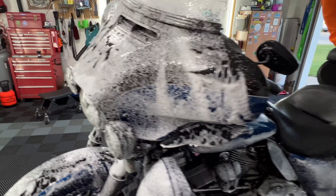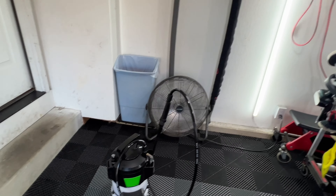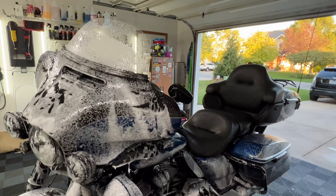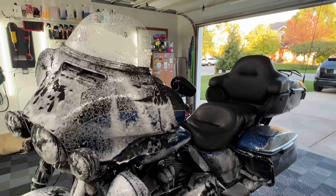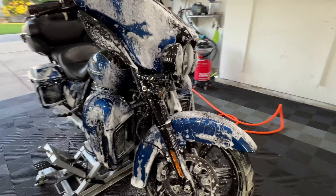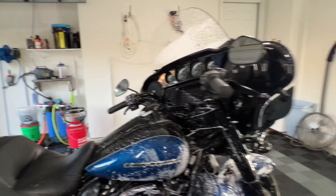We are trying to get as much dirt off with a simple pre-treat and hose method. Then we are going to foam it with my second IK Foamer with DIY Details Incredible Suds. Both IK Foamers are filled with DI water from my CR Spotless so it produces better foam. In the Incredible Suds sprayer, that's two ounces per gallon — so I have four ounces in there. It's a higher pH, around 8 to 8.5, so it does have some cleaning power. We're going to break most of the bugs, dirt, dust, and grit off, then foam it again before we go into our contact wash.